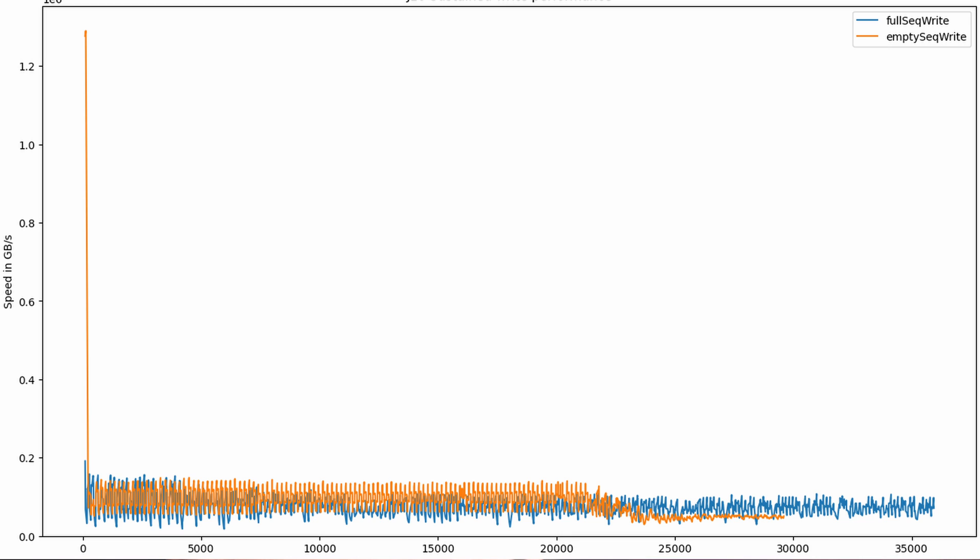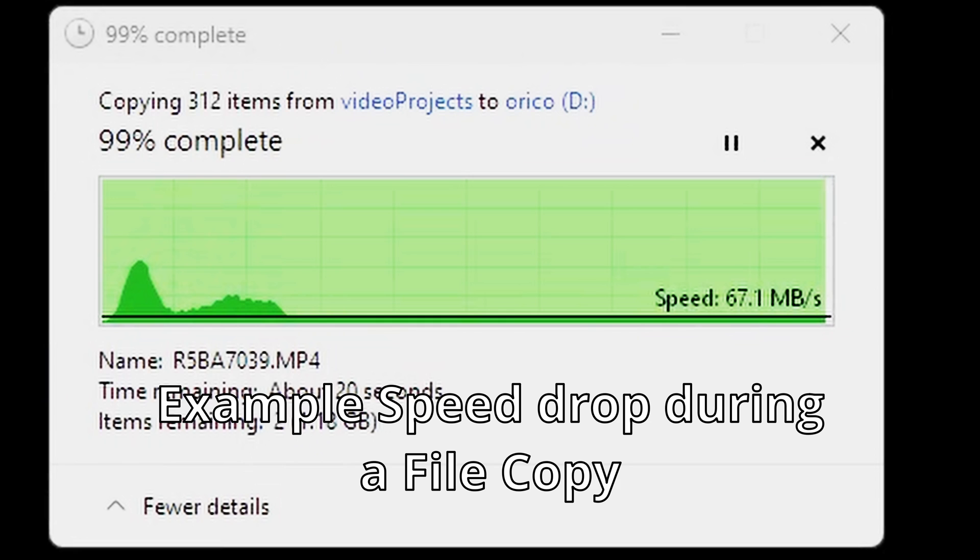The one thing that was most disappointing — especially for a USB use case where you might be copying large amounts of files — is the sustained write performance. Almost all SSDs these days drop write speeds after a period of time due to an internal write buffer. This drive starts writing at about 1.3 GB/s, then averages roughly 75–90 MB/s over a full drive write, which is quite slow. The write cache size is just over 100 GB on a fully empty, trimmed drive, but drops to roughly 10 GB on a completely full drive or without trim, as it's adaptive based on available free space.